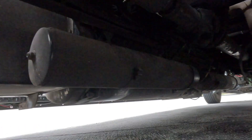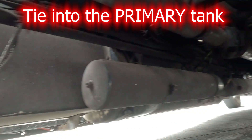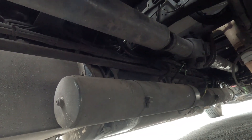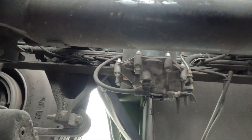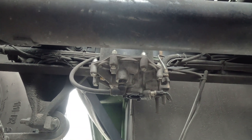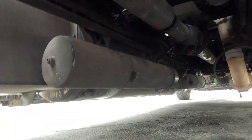That's what you need to do — tie it directly into your air tank. Now some have tied theirs into their dryer. I prefer to just tie mine into the air tank. You get that good surge at first, but if you want to put a T off on your dryer before it goes to your air tank, that's up to you. But me personally, I have mine tied into the air tanks.